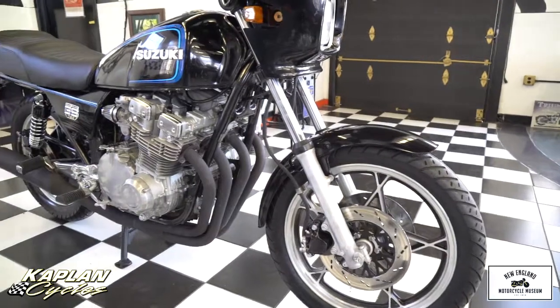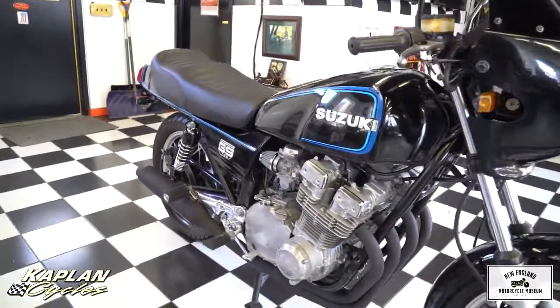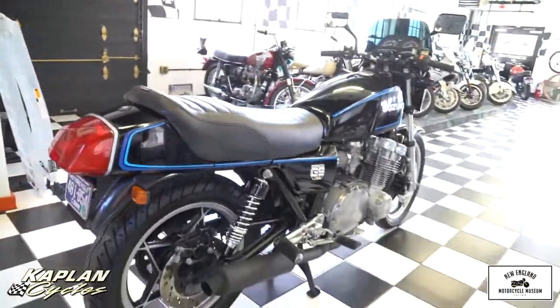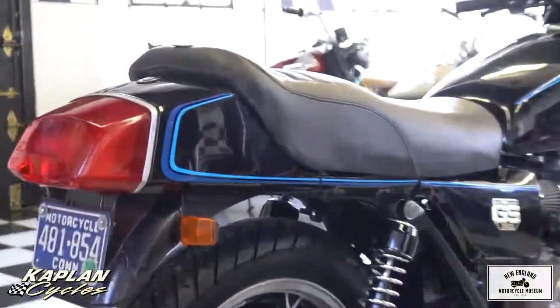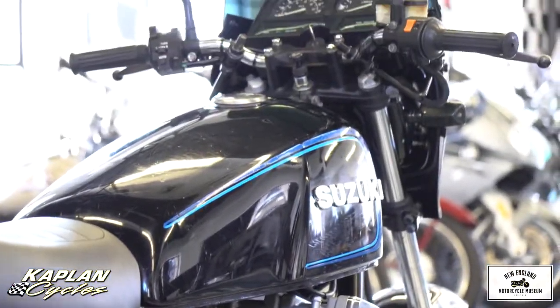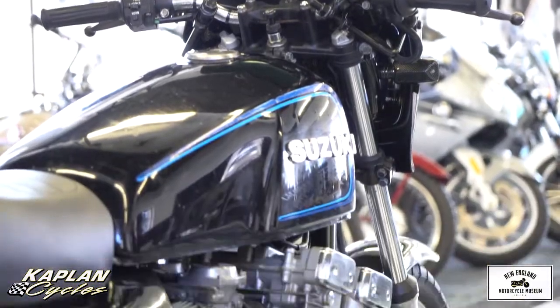We drained all the fuel out of it and started with a clean slate, installed a new battery, tested the cylinder compression, has 150 PSI across the board with good spark. So we removed the spark plugs, tested the ignition coils, the primary and secondary resistance was good. Tested the plug cap resistance, that was a little bit off, so we put four brand new spark plug caps on it, as you can see, and four brand new spark plugs.